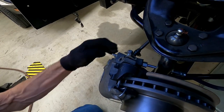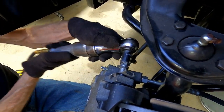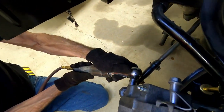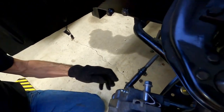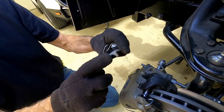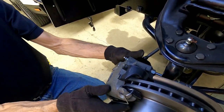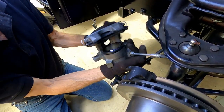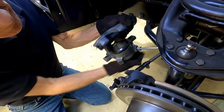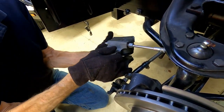You will have to take the brake line loose on the backside — sometimes they're tight, so just loosen it. The second step is to remove the mounting pin bolt assembly. When you take these off, note that they are right and left, marked on one side. At that point the caliper will come loose, and since we loosened the flexible brake line, all you have to do is rotate it to get it off the hose. There is a copper washer gasket right there — don't lose that.